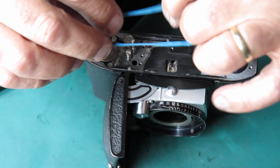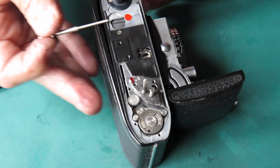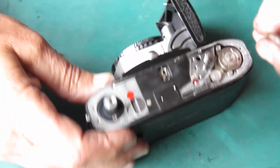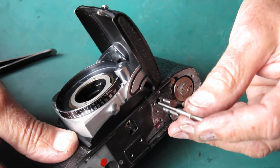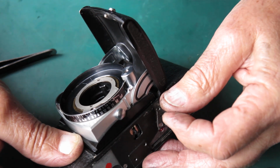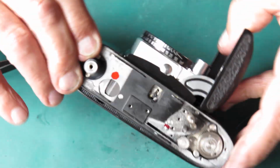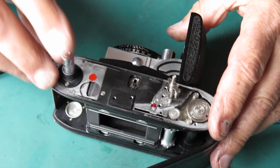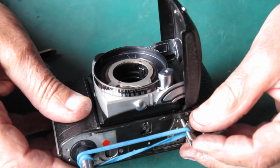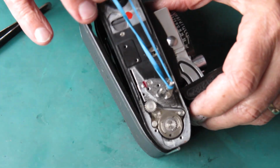Hang on, rubber bands come off here, and so, shutter release has fallen out. Hang on, I've got to rescue this situation, otherwise I'm in trouble. Okay. Get down from the top. Get it gently through the sleeve, gently through the spring. It's in position. That's what happened when I tipped the camera on its head and the rewind went down and the rubber band popped off. And that was nearly curtains.